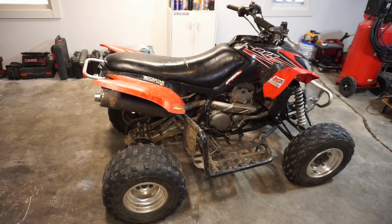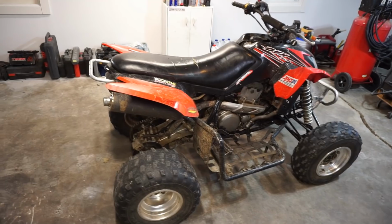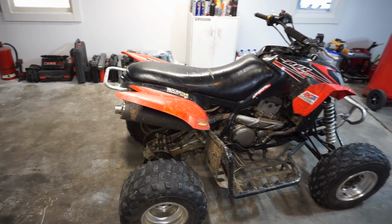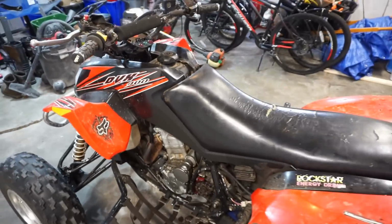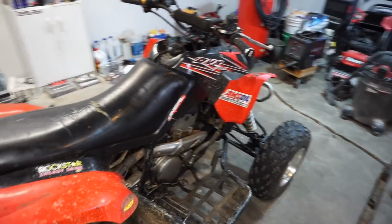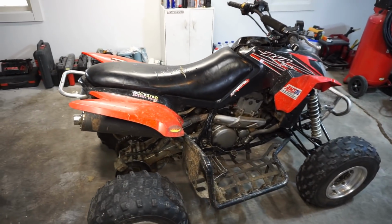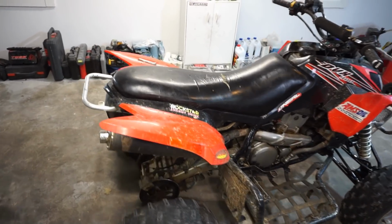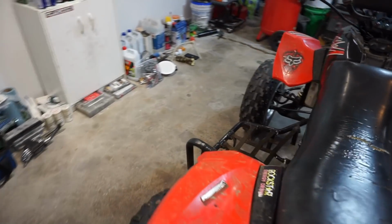This is a 2004 Arctic Cat DVX400. A subscriber actually brought this quad in. He was riding it, he said that it was running good, no problems whatsoever. Then all of a sudden he heard a big clank, the engine shut off, and then he tried to start it back up again, and the one-way bearing is slipping now.